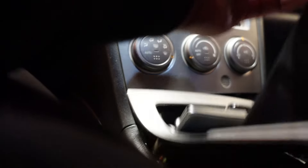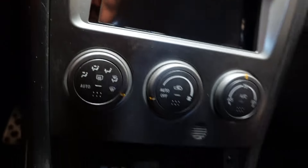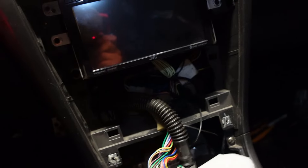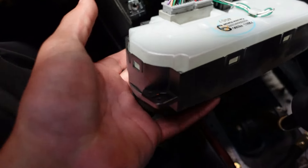If you've never pulled apart this dash, it's very easy. Step one: take off the little button for your STI — it pops right off. Behind it is the cable for the cigarette lighter, so disconnect that. Then the whole panel just slides right off. You don't even need to take the shift knob off.